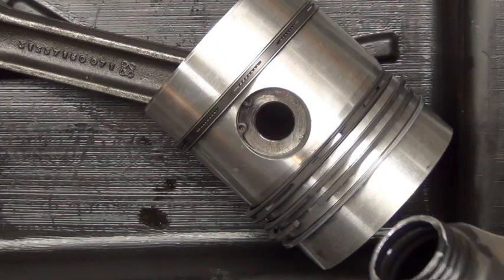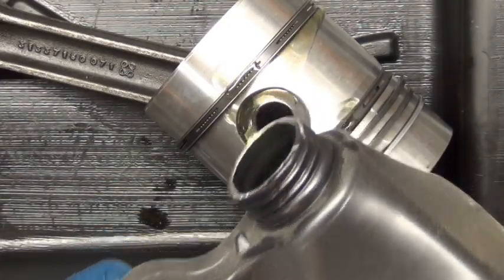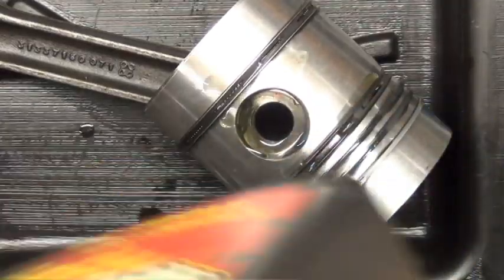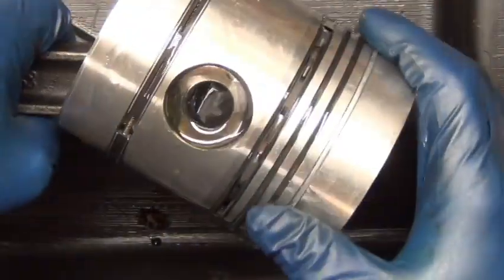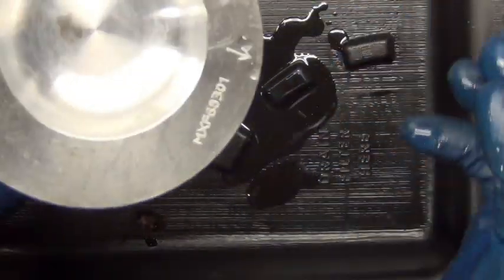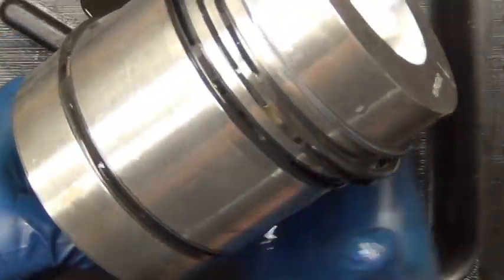This is the messy part. Take oil and basically pour it on the piston rings. I use something that's a little thinner — not because it's rocket science, just because it gets in there better. Move the rings around; this ensures they don't bind or get stuck. If you move them all together, you maintain your gaps. Lube up the piston wall too. The biggest thing: make sure your arrow is pointing to the timing gears, and also down around the bottom tapered section — it's got to be able to slide down through the piston ring compressor.